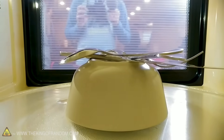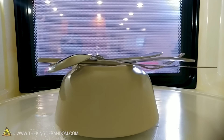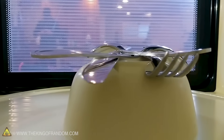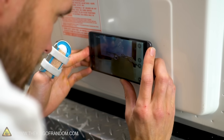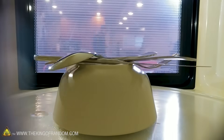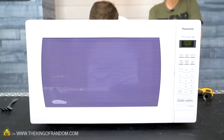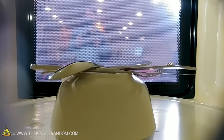Let's see how this does — three minutes. Oh, it's messing with my phone again. Phone cameras don't like getting hit with microwaves. But we are getting sparking sooner, and a little bit more — a little more energetic. The nature of the Faraday cage formed by the steel walls causes microwaves to bounce around, so in theory they hit everywhere, but a little bit off the plate does seem to get heated up a bit more and faster. This is still pretty minor compared to the aluminum foil. All right — probably good at a minute thirty.